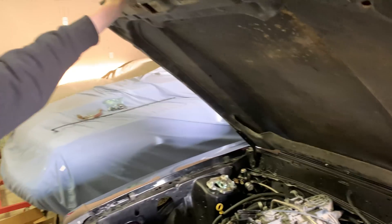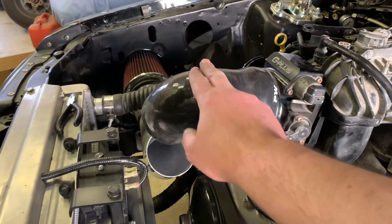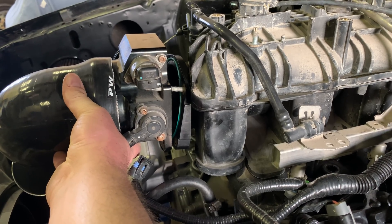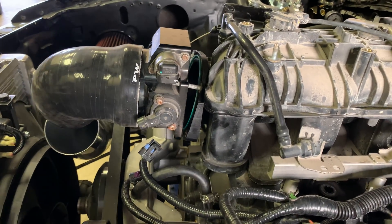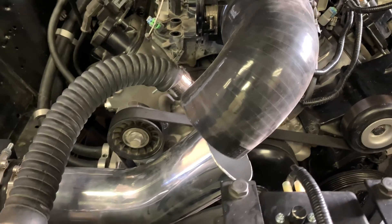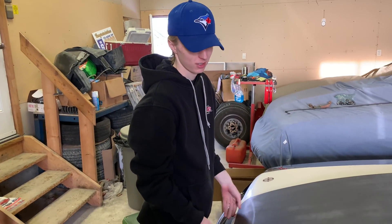We have to be careful not to go too close to the hood pin hole, but we should be able to make everything work. We definitely have clearance from the hood to the intake. We threw the throttle body on — it's very close right at the top of the intake elbow. I was thinking of possibly machining an angled spacer to correct some of that, which would let us retain our elbow and 45-degree bend without having to lengthen any of that. We'll figure it out when we get there.